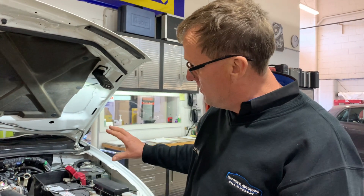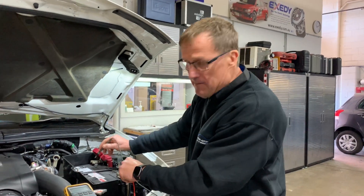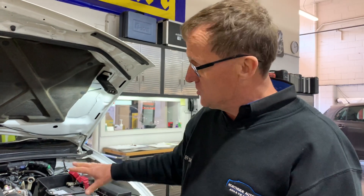But make sure when you use your voltmeters, know where you're testing. Don't just assume you know where the problem is — it may not be there. Check those earths. It's critical in the later model cars that we don't have any voltage drops, especially in the main battery area. Hope that helps you out for next time, but this one here is a quick and easy fix. See you next time.